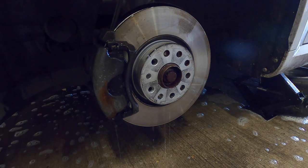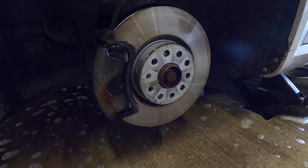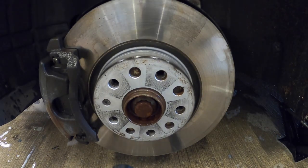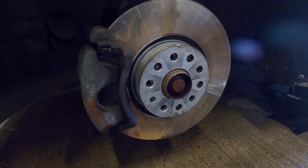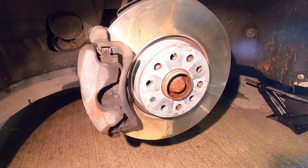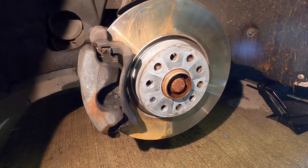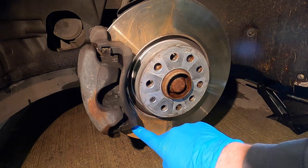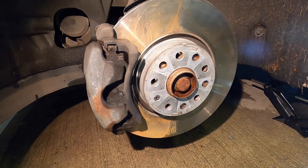I'm going to set the camera up on fast mode and see what evolves in front of our eyes. Okay guys, that's it - left an hour. I'm going to take some photographs as well. That's the line there - this was the protected side, and that was the unprotected side. And I don't know if you can see - protected here, and all that nasty stuff we're trying to avoid, all that flash corrosion on the other side. I think it's quite clear.